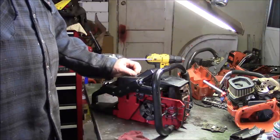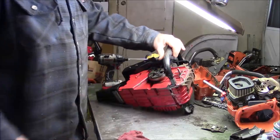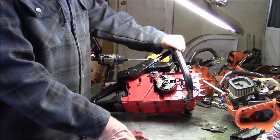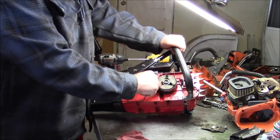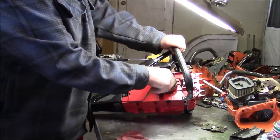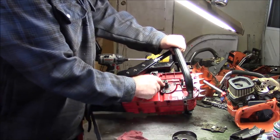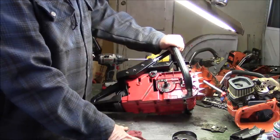And when I started doing the analysis, I realized pretty quick that it was sucking air right through the PTO seal. And I may have actually run this on the channel where I shot some brake clean in there and pointed out the fact that it just was drawing air right through that seal. That seal is just whooped. So what do you do about it?